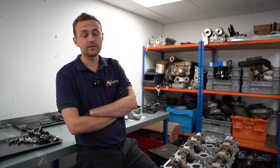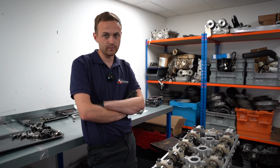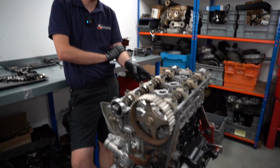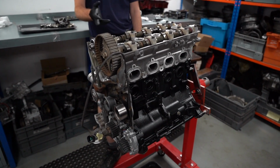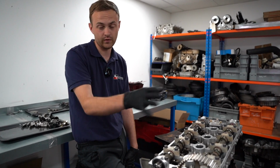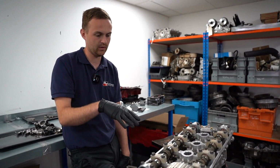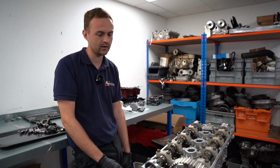Okay. Yeah, so right, we're back the following week. Little update. I think the last little snippet we saw was the cylinder head going on. Since then, it's now been torqued up. Studs have gone in, ARP 2000s, torqued in sequence in 3 stages. All the head stuff is being reused, cleaned and blown out, and made sure everything's okay, checking clearances yet again, making sure everything's in spec.